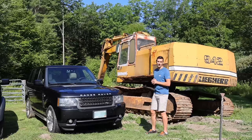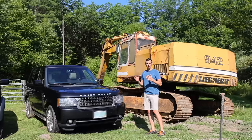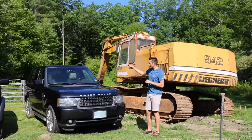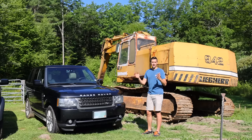Some of you may be expecting me to hop in my new excavator and crush this thing with the enormous bucket — however, if I did that, what would I do in part five of this series? In all seriousness, let me know in the comments what you think I should do with this. A lot of you have been recommending an LS swap and that's definitely something I'd consider. One of the biggest difficulties is the computer integration — everything is computerized in this vehicle and messages from the engine get sent to the transmission and instrument cluster over the CAN bus, and the message format is proprietary and would need to be reverse engineered.